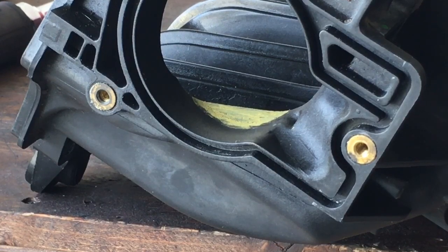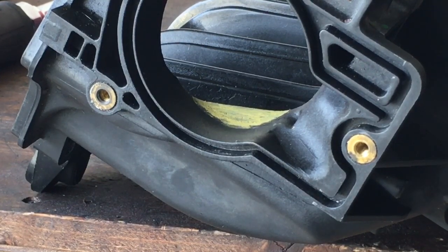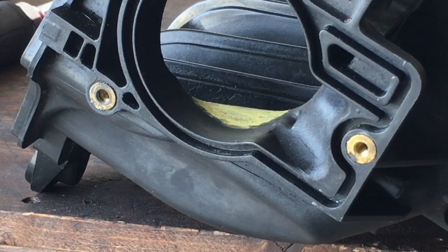For airflow to support boost and horsepower, there's no real benefit to necking down or trying to deflect air. That's a pretty substantial restriction and it's just weird. In an airflow sense, it is a foil or like a deflector. There are a couple of little areas just inside there where your throttle body bolts on that can pick up some decent numbers and improve your volume of air. I wanted to give you guys a look at that before I started whittling on it.